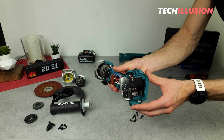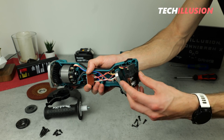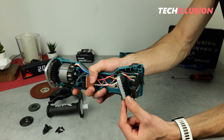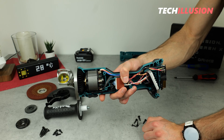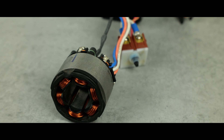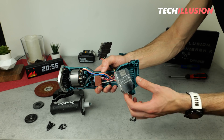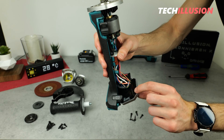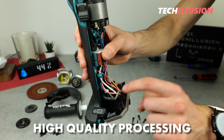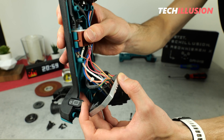The integrated technology might seem complex at first glance, but becomes quite understandable on closer inspection. Let's start all the way at the back where the power comes in. At the contact plate, as we know it from all other Makita devices, there are a total of three pins: plus, minus, and the control pin. Directly in front of it is a small board — the motor control — because since we have a brushless motor installed, which is significantly more complex than a brushed motor, we need a control unit to operate the motor accordingly. This small board, located at the back and equipped with aluminum on the back side to enhance heat dissipation, is the heart of the angle grinder. The entire board is glued where all the cables and contacts enter, meaning it's sealed — no water or dirt can get in, ensuring the control unit is very well protected.